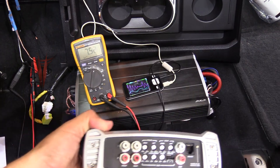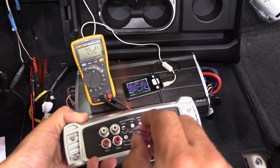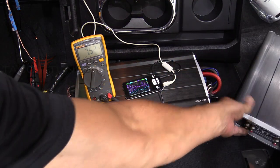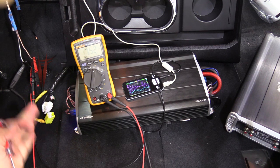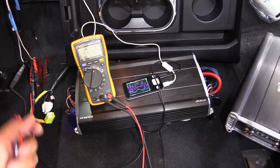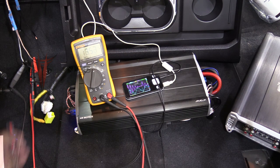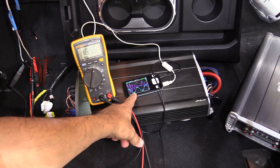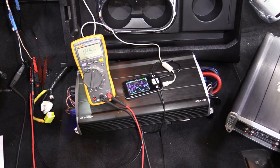Taking the amplifier, starting with front left: I'm going to take the input sensitivity, which should be all the way down, and start turning it upward. Our target voltage is 18.5 volts. We're using the 1kHz test tone, which is track number 6—the negative 3dB test tone.